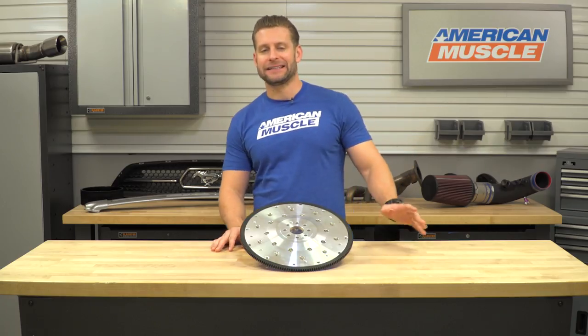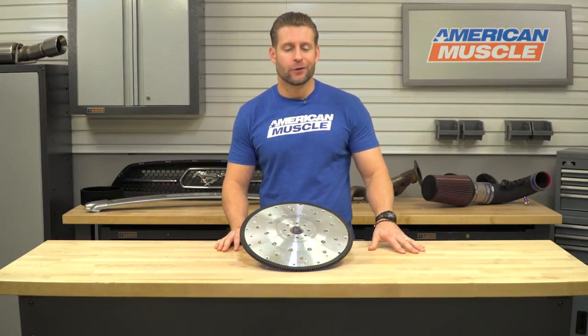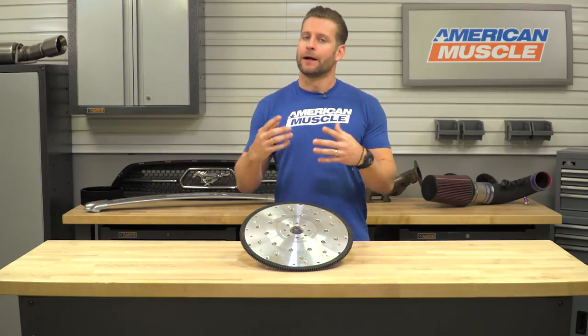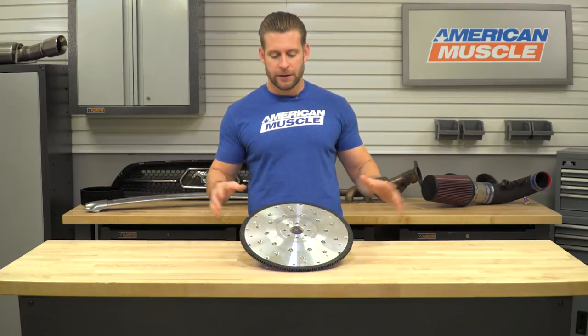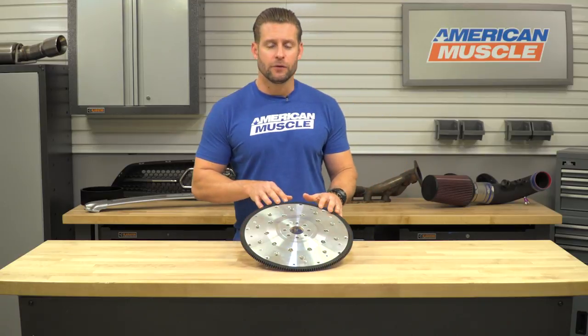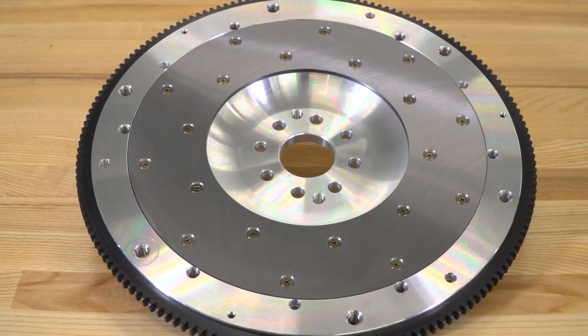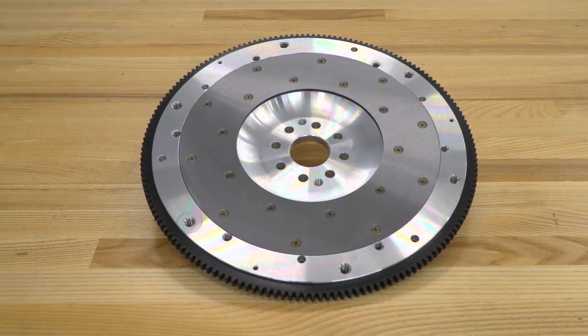A lot of you watching are probably wondering whether you have a six-bolt main or an eight-bolt main. Romeo-built engines feature a six-bolt main, whereas Windsor-built engines feature an eight-bolt main. This is mainly directed towards the older SN95 GTs, because pretty much all of the S197 GT and Boss Mustangs, along with the older four-valve cars like the Cobras and Mach 1s, all feature an eight-bolt main. A quick way to find out is by checking your VIN number. If the eighth character is a W, you have a Romeo-built engine with a six-bolt crank — this flywheel will not be for you. If you have an X in the eighth position, you have a Windsor-built engine with the corresponding eight-bolt main crankshaft, meaning this flywheel from McLeod will work for you.